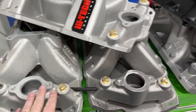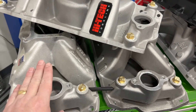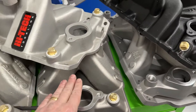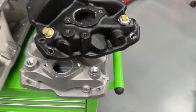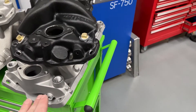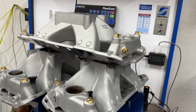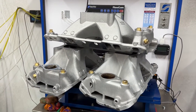These intakes are all about the same height. This is an Edelbrock Super Victor 2925. This is a Brodix BM-1000. This is the AFR 4811, which has got an interesting story — I'll show you in a minute. These three are Hurricane intakes from Professional Products, but they're all different. So let me get these apart so I can show you some of the measurements.